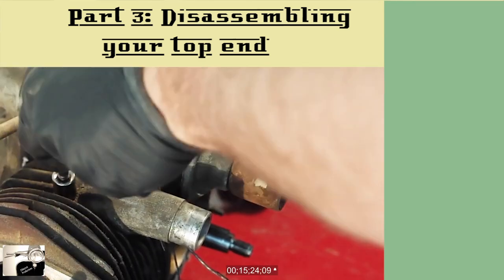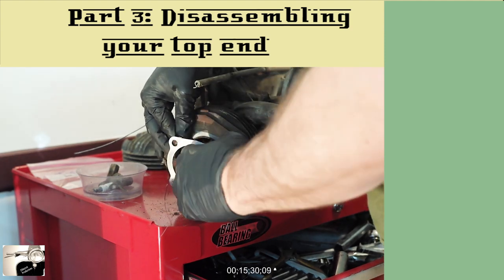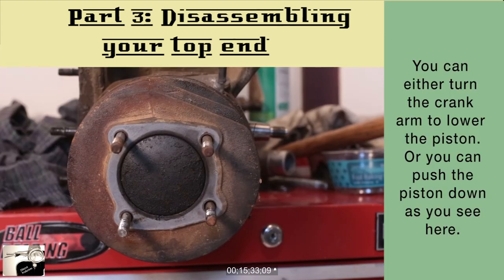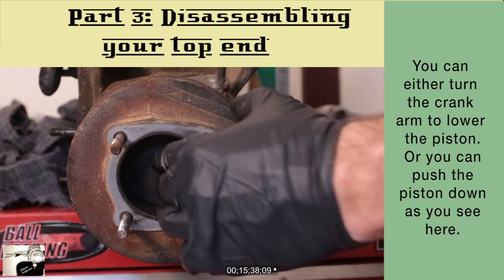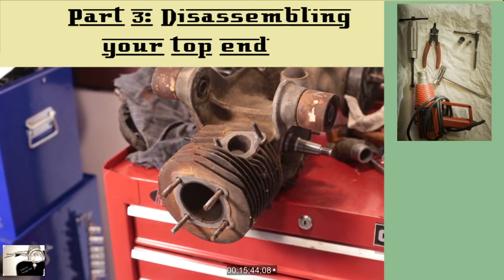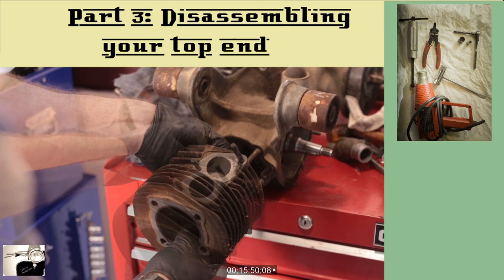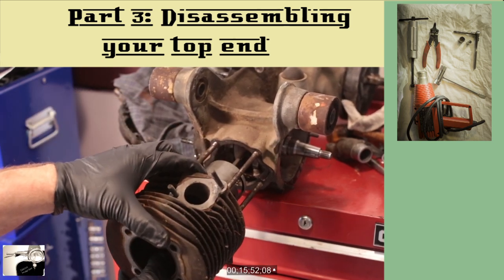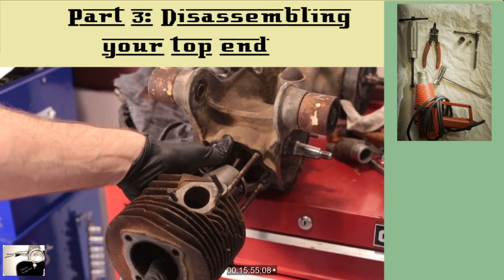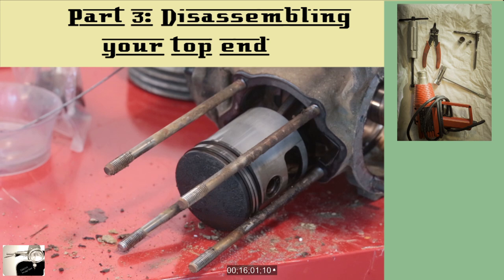Now with a socket wrench, we're going to remove the two nuts that hold the carburetor mount to the top end. If you haven't already, take a moment and remove the head gasket. Next up, we'll start by turning your crank arm, or you can just push the piston to bottom dead center so the piston is at the very bottom of the cylinder. Now with your hands, take a strong and careful hold of your cylinder and slowly pull it directly away from the engine along the four shafts that hold it. Go slowly as the base gasket might be sticky. Do not force the cylinder off, but nonetheless be firm when pulling the cylinder free. Lastly, remove the base gasket if needed.